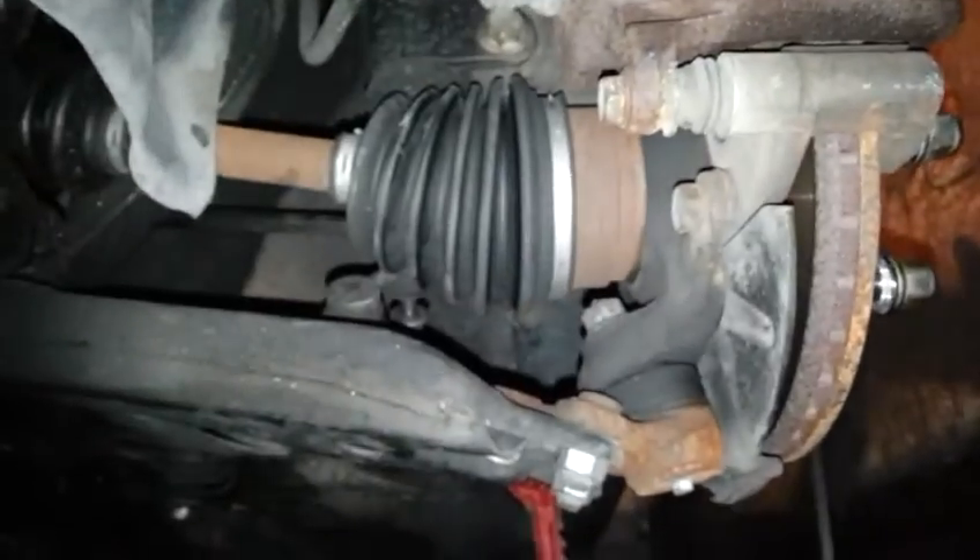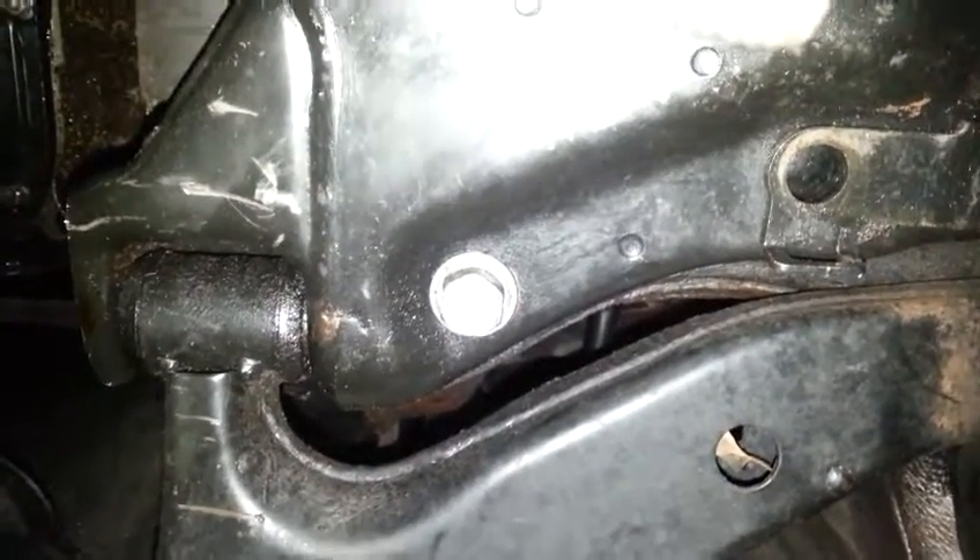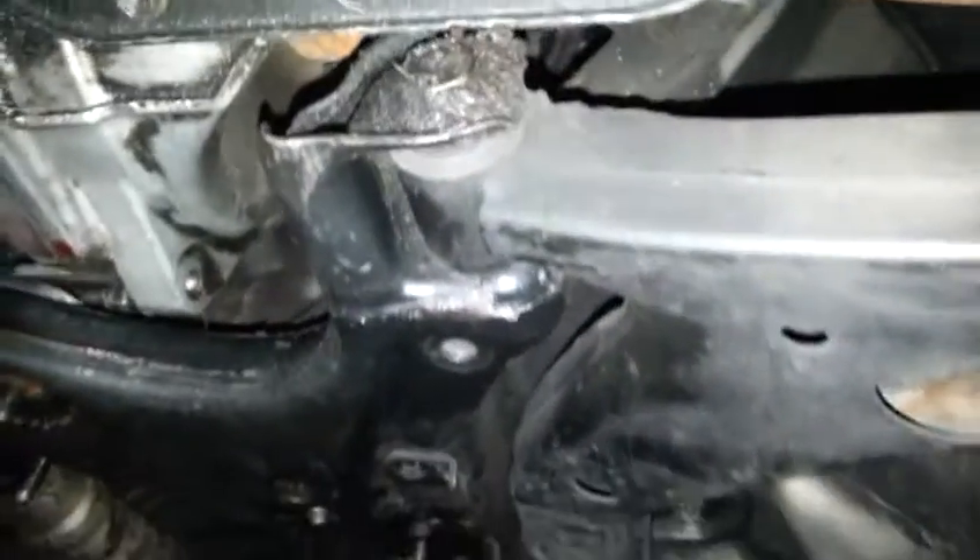So this whole subframe has to come out. I'm going to pull the three bolts to hold the steering knuckle in, because the control arm is coming down. I have to pull the bolt back here. All those bolts are already pulled on each side. This has to come, this guy has to come off. And of course the three bolts holding the control arm on the opposite side have to come — just like these three. Not this one, but these three.